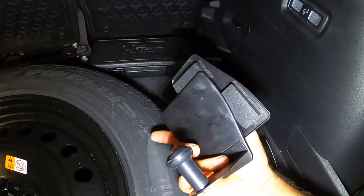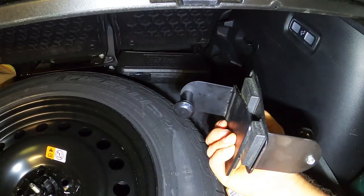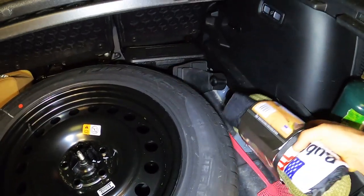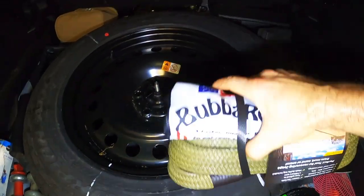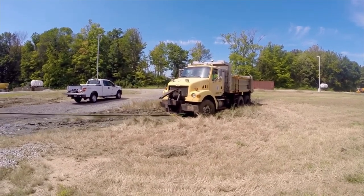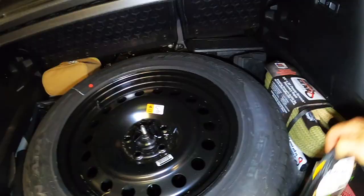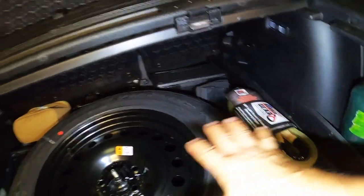This gadget is a magnetic paper towel holder — I just stick this on the side of the car, hang your paper towels from it, and it's got rubber coating so it's easy on the paint. Here I have my recovery rope, which I have not needed to use yet. This is by Bubba Rope and you can find these at hrgoffroad.com — it's a 20-foot recovery stretch rope. These are a kinetic rope, so the pulling vehicle gets some momentum and the rope stretches out, absorbs the shock, and yanks the stuck vehicle free without damaging anything. Super handy if you get stuck in the mud. I also have a soft shackle, which is super strong and will protect your hookup points, plus d-rings just in case.